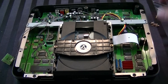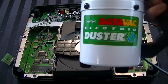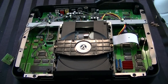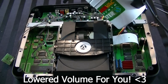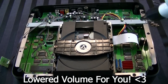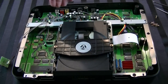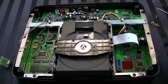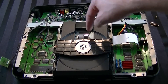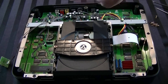So we'll just do some spot cleaning. The first and easiest thing we can do is get as much dust out of there as possible using an electric duster - this is the DataVac electric duster. You can also use canned air duster. I apologize, it's going to get a little loud. Most of the dust seems to have accumulated in the back near the open ports, so I'm focusing there. I'm definitely not going to aim it into the laser assembly though - I'll leave that to more precise spot cleaning.